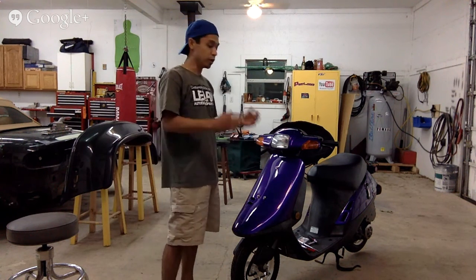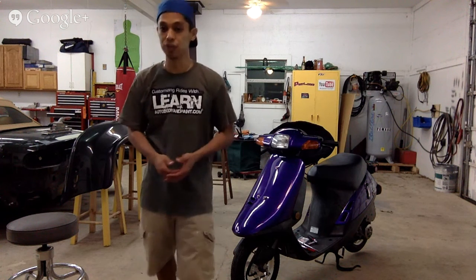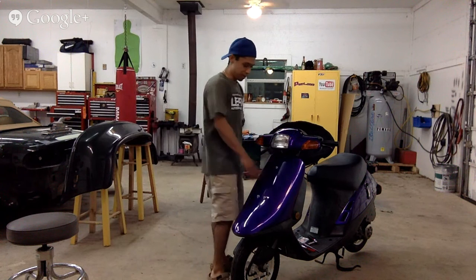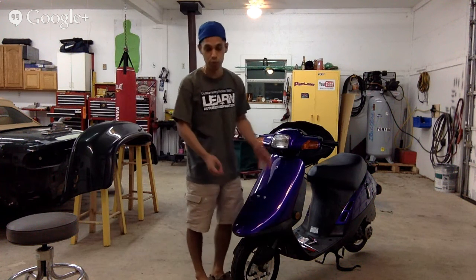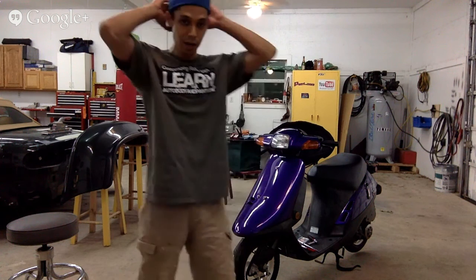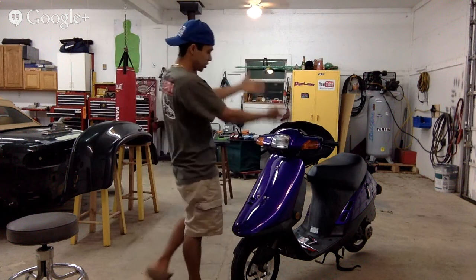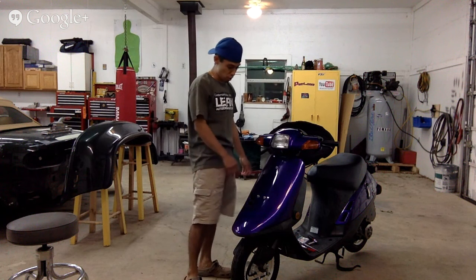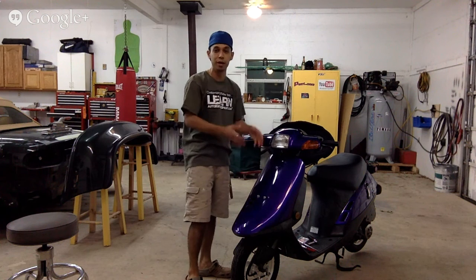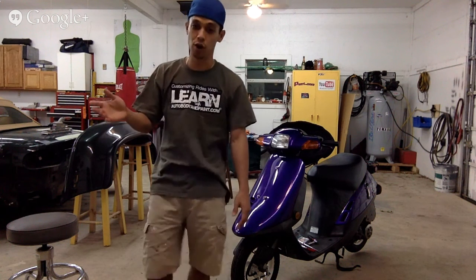So first thing you want to do when starting out on a project is clean it, make sure it's clean, okay? Because you don't want to get grease all over the place, because when you're dealing with paints and stuff, grease and wax is your worst enemy, okay? So I washed it down, all right, it's clean. We're going to take all the panels off tonight, strip it, and then we're going to start preparing it for paint, which is going to be in the next show, next episode.